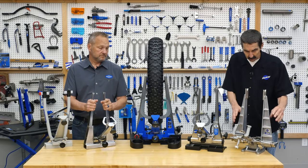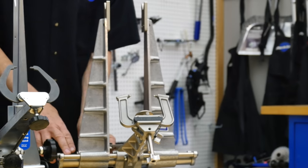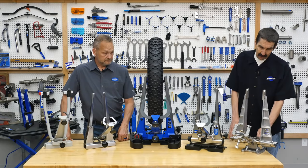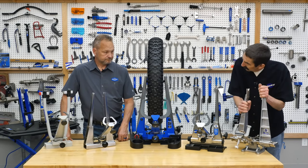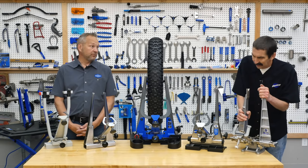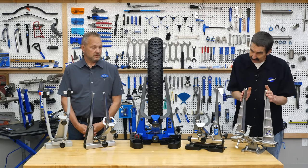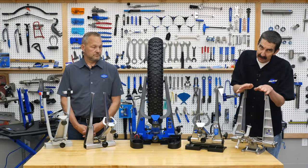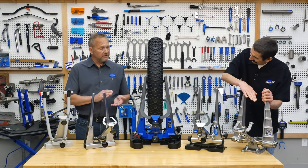The TS-3 is a different paradigm — a really fun stand. It moves on 12 bearings, much like suspension fork stanchions, so the bearings let it move smoothly and centered, with both arms moving parallel — a unique feature. However, it relies on a quick-release skewer, and of course now when everything is through axle, this isn't going to work well. In addition, the larger tire sizes we have now would not fit here.